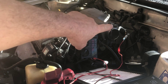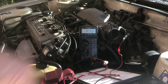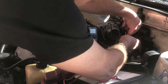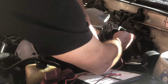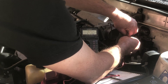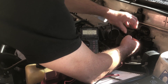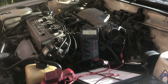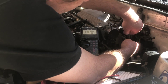I've got a little spring there — it just makes it easier to back-probe. We have five volts at the power wire. You can see we have ground, so we go to the second wire down.